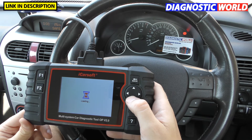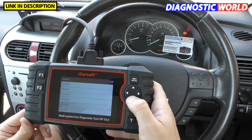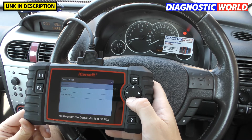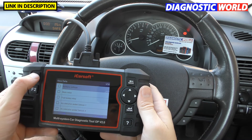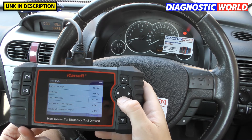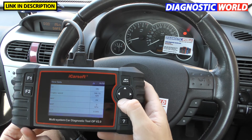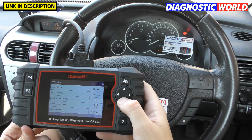Let me show you a little bit of live data. Selecting our 2004 Corsa C and going into the engine module, we have 52 bits of potential live data to look at. Selecting all with F1 and pressing F2 to start shows all the live data from the vehicle. You can view live data from the engine, transmission, and ABS sensors, depending on which module you're in. It's quite slow to scroll through, which encourages you to actually read the information.